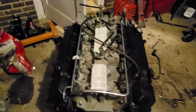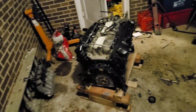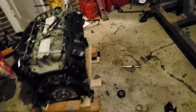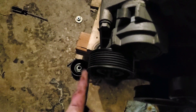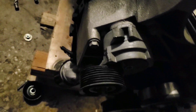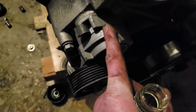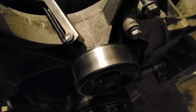Tomorrow we'll get done on this guy — just get it all dressed up, buttoned up. Get the intake back on it, get the flywheel and torque converter, which is all over here. The fan — gotta get that on too. Went ahead and replaced this right here. Turns out somebody already had a smog pump delete pulley on here, and when I went to take it off I noticed they honed out the very top. So I just replaced it with a good pulley. Spins nicely — even WD-40'd it.